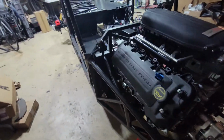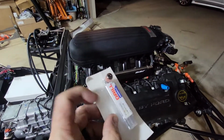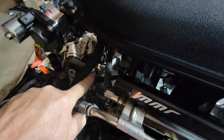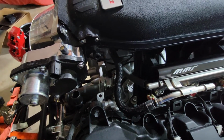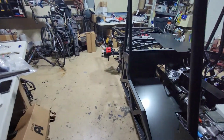And then, let me get the other piece. They provide a tap and a bleed screw. Go over here again. That removes the steam line fitting off of there, and then you bleed the system using the bleed screw right there. You're basically removing the degas tank out of the equation, and then you just run a normal arrangement like you would on a 302 short block or anything. So it'll get bled at the highest point, and then we'll be done.